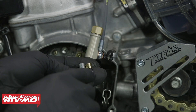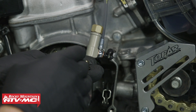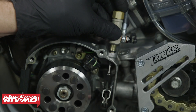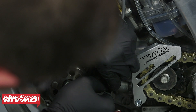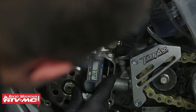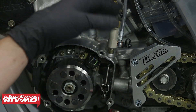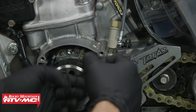The kit did come with a couple of different size collars. First we'll try the smaller one. We're going to check the play after that, and then if we need to adjust it, we'll switch to the bigger collar. Before I slide this on, I'm going to put just a little bit of grease on that O-ring just to help it slide in and out easier. We'll just pop that rod right into place on the actuating arm. Now, I'm going to pull up on the slave cylinder and use our caliper to measure the free play. On these, we want between 4 and 6 millimeters of free play. We're just a little over 4 millimeters, so we're good to go. If we had a ton of free play in there, we could try installing the taller collar to take it up.